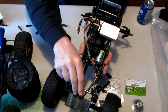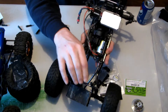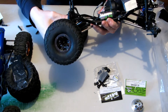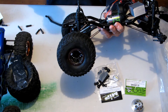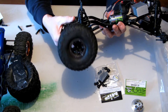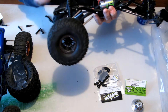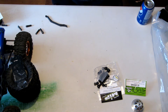I took the oil out of the shocks and replaced them with inner springs, so now they have both internal springs and external springs. I'm not sure how much I'm going to like that — I've tested it and find it's a little bit stiff. You'll see it in an upcoming video. That setup will probably change again because I'm not quite happy with it.